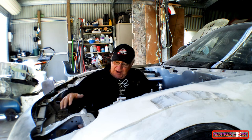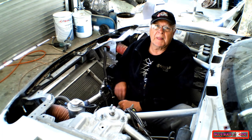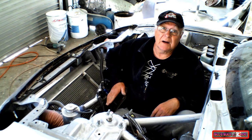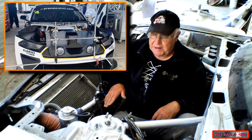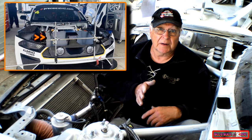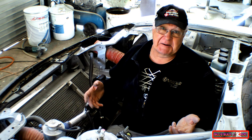But if it goes up, out and over the top of your bonnet, it increases that airflow and creates downforce, two things you do want in a race car. I will be suggesting that my client add ducting from the bottom of the radiators curving up to the back of the vents in the bonnet to achieve this. Depending on what else has to go in here, of course.